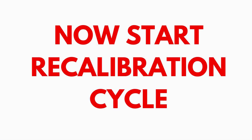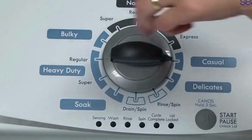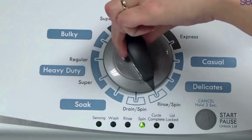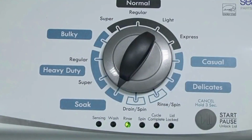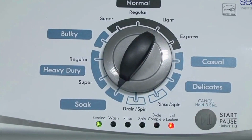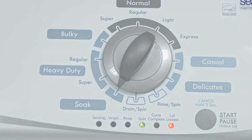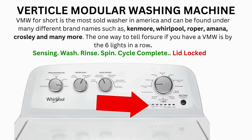In the diagnostic mode, with all lights flashing, select the calibration cycle by turning the control dial 4 clicks clockwise, or 4 clicks right. When you're on the correct setting, the rinse light turns on, then you simply press start. It begins the calibration cycle, which runs for 2-3 minutes as it checks all the cycles and functions on your machine. When the calibration cycle ends, if all goes well, the lid unlocks and the washer shuts off. Now try your washer to see if that's solved your issues; if not, continue to the error code video.